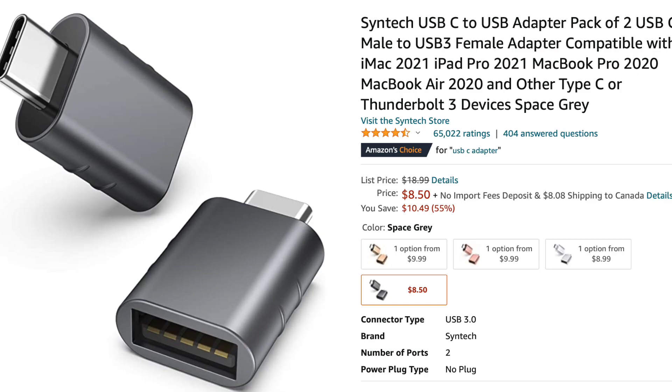It comes with a USB-C to USB-A cable, which is handy, and a double male USB cable. Mac users — if you have a Mac that only has Thunderbolt or USB-C ports, do not use a USB-A cable with a cheap adapter on the end. I see a lot of you doing that and then asking why your footage is choppy — it's always the adapter. Use the proper cable: USB-C on one end into your Mac, USB-A into the capture card.